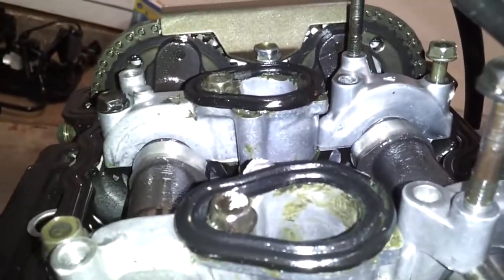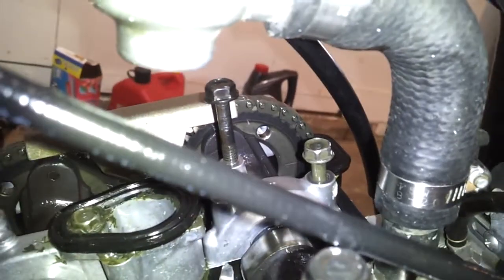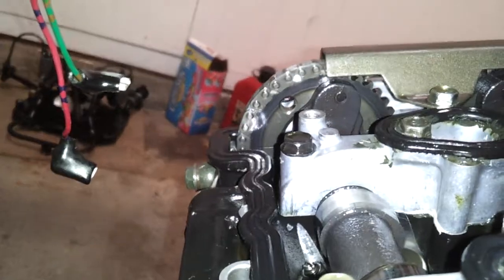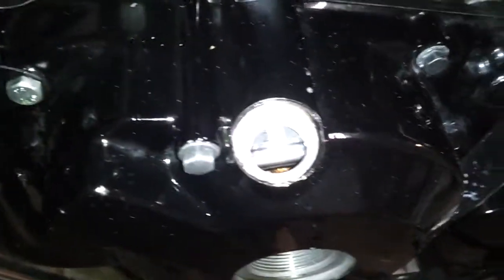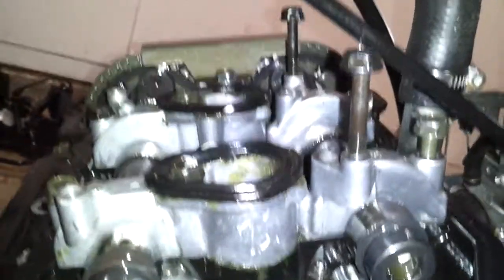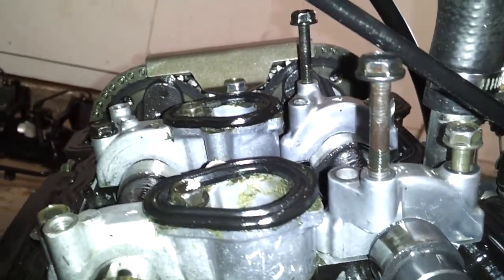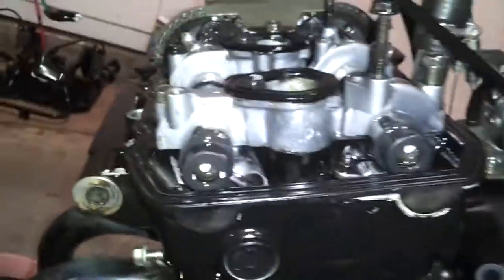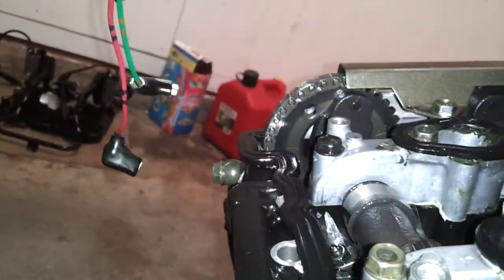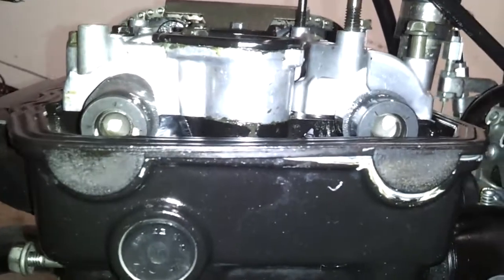Because these lobes are facing the wrong direction, when you go around again this one is going to have the letters IN above it and this one is going to have the letters EX. When both sides are lined up with the case and that shows 2T, you know that your timing is set where it needs to be. Since it's pretty much the exact opposite, doing one more revolution should get you there. The proper way would be to bring it around again — lobes facing the other direction — and make sure those two lines say IN and EX, running at the same level with the top of the case. That's your timing.